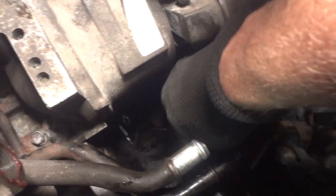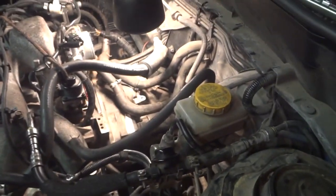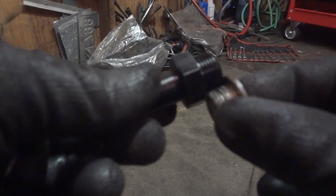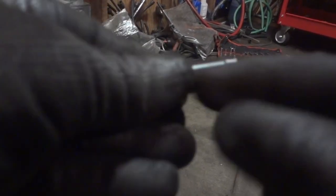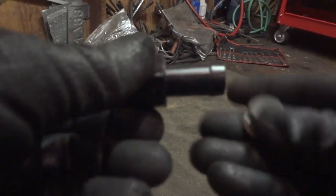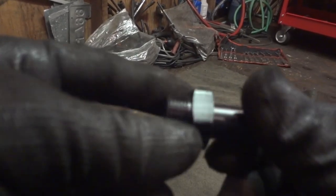This is a special plug — special threads. So that's out. I'm going to screw this fitting in here and check these threads real quick and make sure they're the same. Yep, same threads — I'm not sure what the thread count is per inch, but the pitch and diameter are the same. We'll get this in. The nice thing is when you get this so far, you don't have the whole length sticking out — you only have about this much sticking out. That might help me to get a tube bent around that EGR tube. Let's go ahead and get this in, put a little silicone on it, use a deep-well socket, put this in, snug it down, and we'll see what we can do.